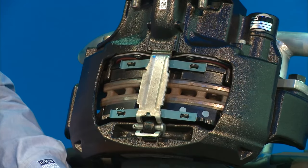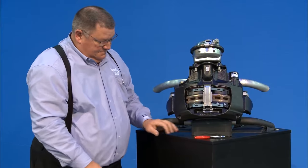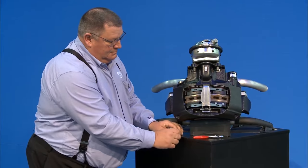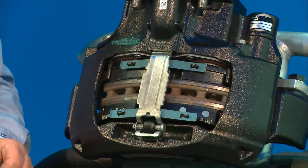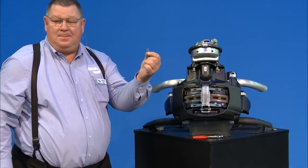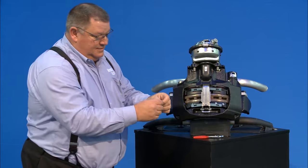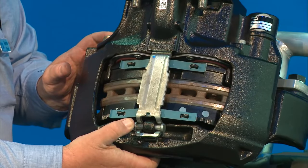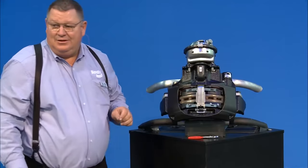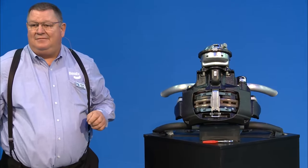Put your pin in, then take your new washer. Take your new spring clip — it just pushes into the hole and snaps in. Pads are in and the pad retaining bar is on.